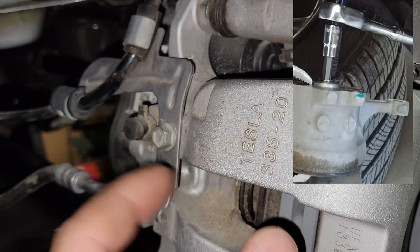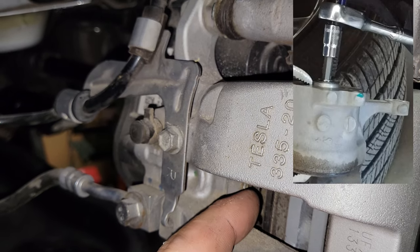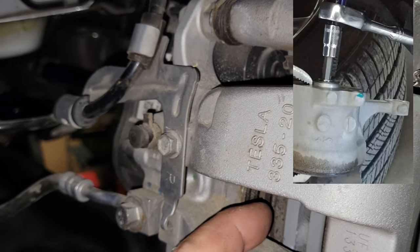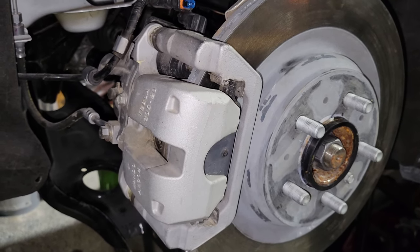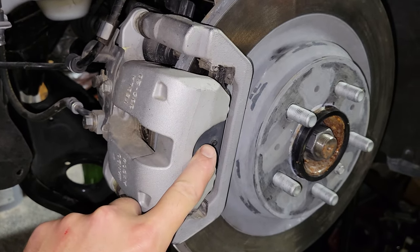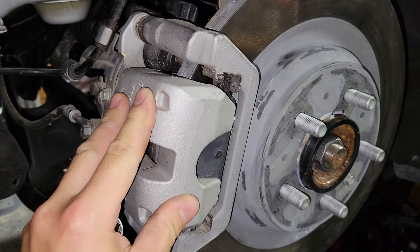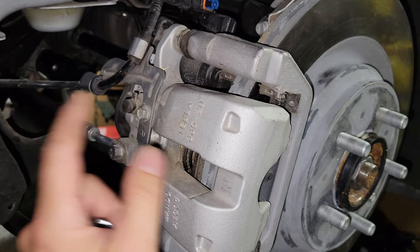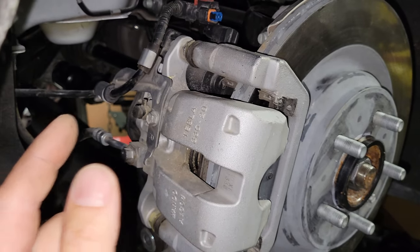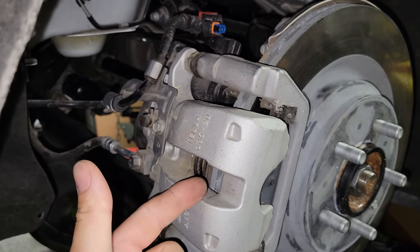That should shrink in carefully and smoothly — don't do it fast, be nice and careful. You want to make sure to push it all the way in until it is flush with the rubber seals in the back. Now you are ready for reassembly. Simply put your new pads back into the caliper, lay the top half of your caliper back on, bolt back on the rear electronic parking brake, and put two more bolts in. As you step on the brake pedal, like any other car, this thing will tighten in for you.